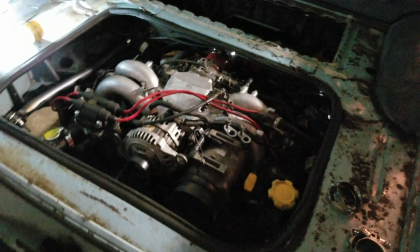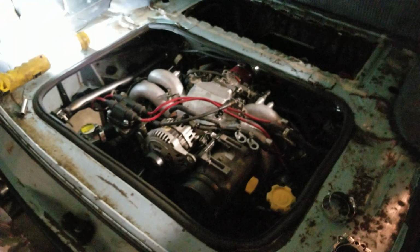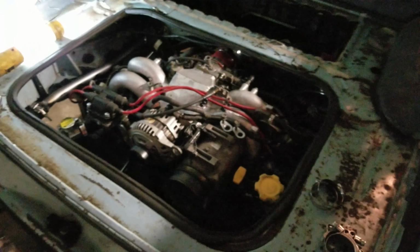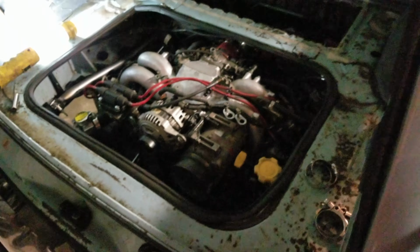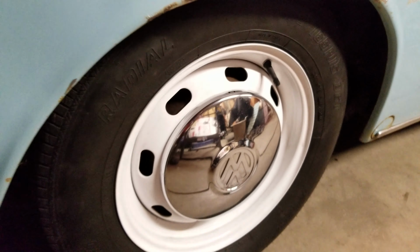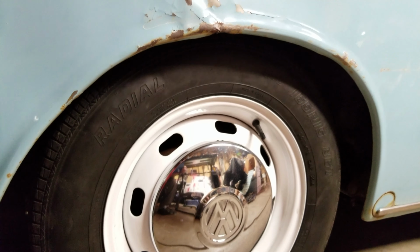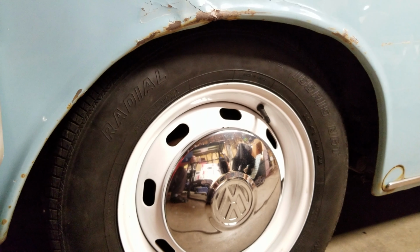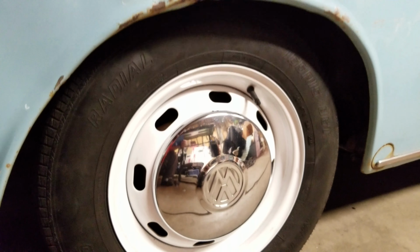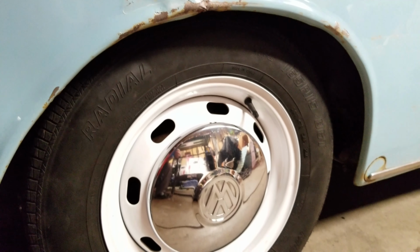The other thing, not really able to get a very good view of it, but the oil pan does set kind of low. Didn't have too much of a problem besides one little spot pulling out of my driveway. I have to be a little careful coming out of that. It's a stock depth oil pan, didn't cut it down or anything. Don't plan on it, mostly because I'm not a person that likes to drag the pan, and putting this motor in has lowered the rear end a little bit. So I'll probably raise the rear about one more click. That should give me about 1.5 inches in the rear, I think, if I remember right.